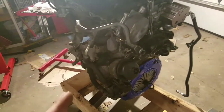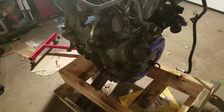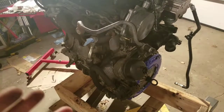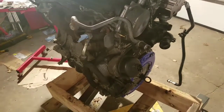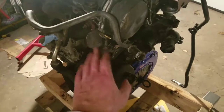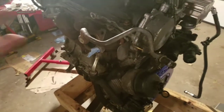It has oil all throughout the engine, and you don't have to worry about any initial engine wear. The other way, which I may have to do because the first option is kind of difficult, and I'm not entirely sure how to do it, is to just crank it without the spark plugs in. And I know that gives you initial wear, but it really only takes like a second or two for the oil pump to get oil distributed throughout the engine. On top of that, I'm going to pour oil inside the oil filter, so that should help as far as getting oil sucked in through the engine faster.